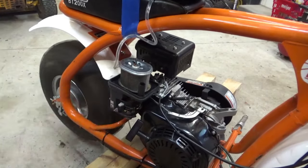Well, it's not loosening because, as you can see, those threads are boogered, so no matter how much you spin this nut, it doesn't track down them. So it is loose enough here that if I take off the axle bolt, I think we can just pop this, I don't know if you want to call it a banjo setup or whatever, and get tension off of the belt that way. Okay, this is loose enough now. We should be able to take this master link off.